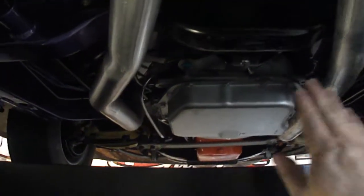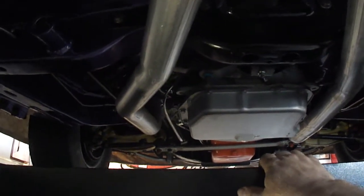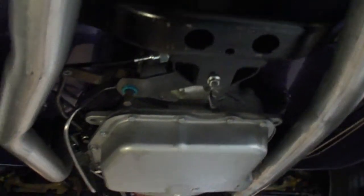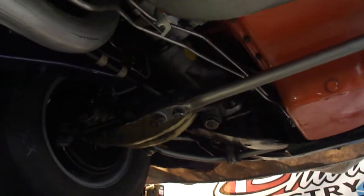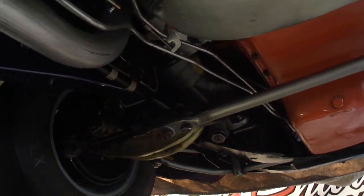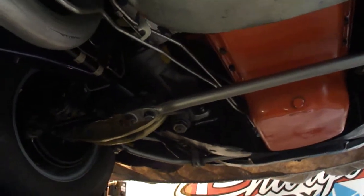Let's move up here. Now this is my drip tray trough, so I'm going to have to move this. So it's going to be noisy. Sometimes I get hit in the head. Move that back. And so then you can see the torsion bars right there and there. They run all the way up. The torsion bars have stripes coated on them that tell the factory line workers what type of bar it is, what thickness it is, and that's how they determine what to put on the car.